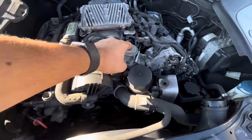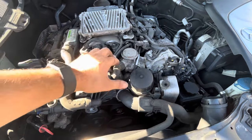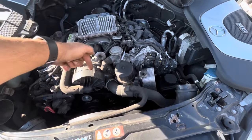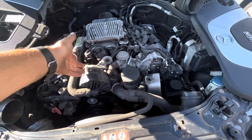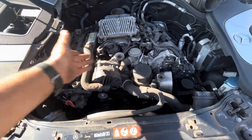The gate valves, a lot of times, they stick. They stick open, and what that causes is when the pump is commanded to stop running, the exhaust backs up and sends the exhaust fumes and water and everything else right into the air pump, and then it prematurely fails.